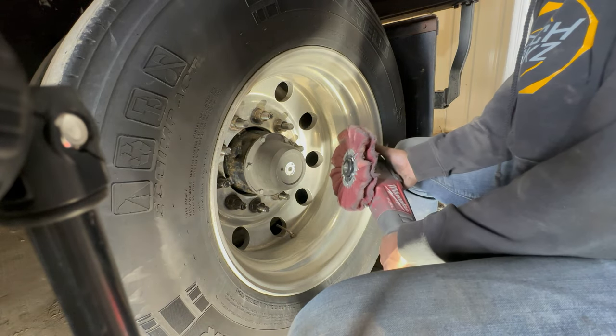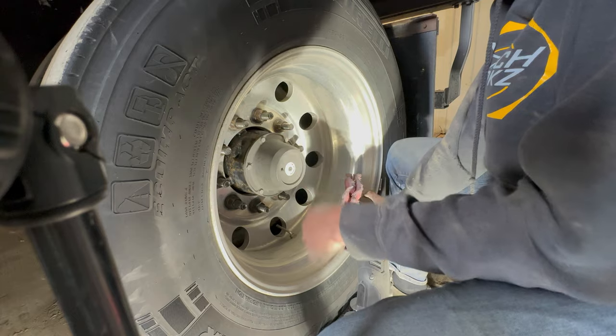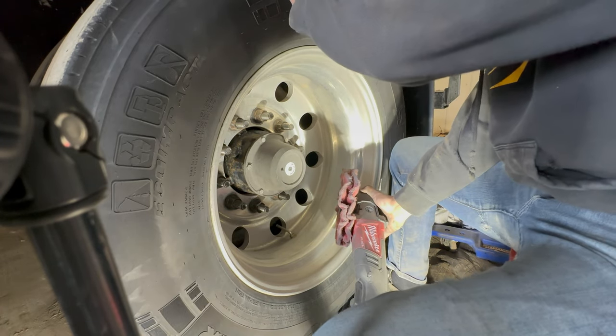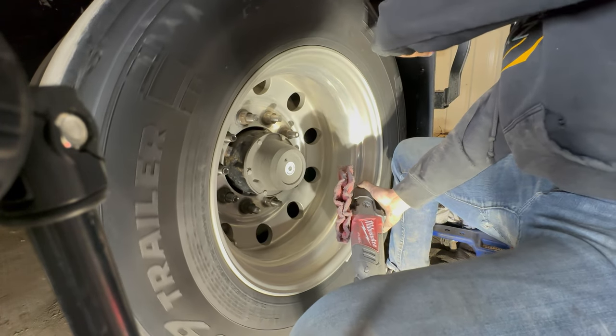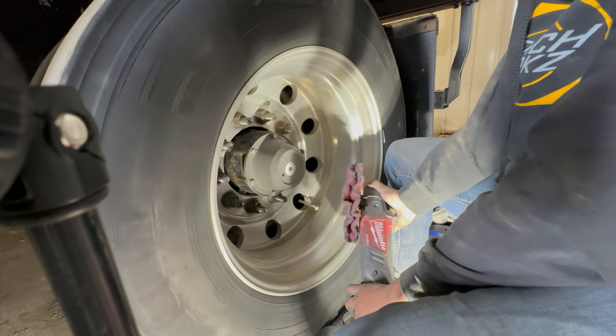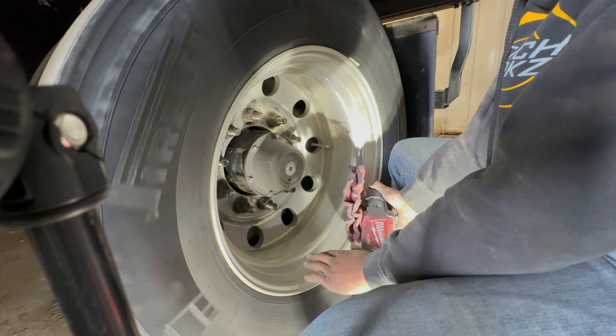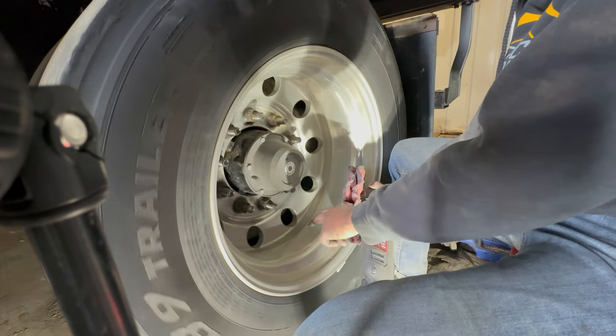I don't think it really matters which way you go. I normally always start this way first. I spin the wheel while I go. The polisher is going to try to push the wheel this way, so I always spin the wheel first and then I'll start sanding. You can see as you sand and as you polish, you'll see a line in your wheel,